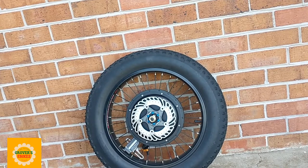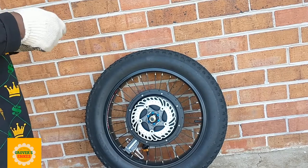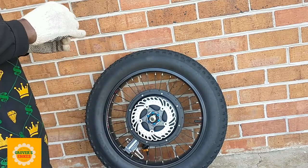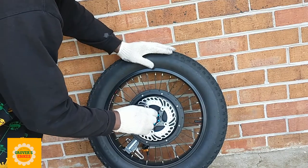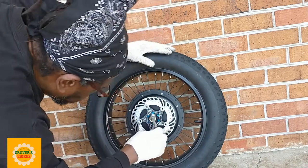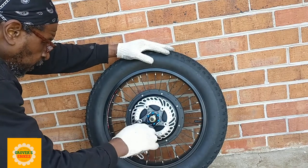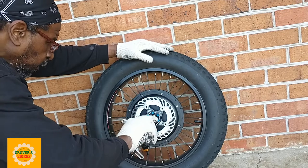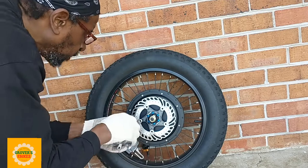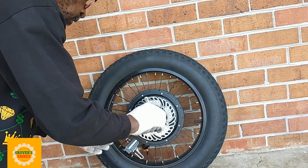So once you have your disc up there, you want to tighten it up the same way, back and forth 180 degrees, and then you want to go all the way around in a circle to make sure that all these little nuts are tightened up. I think it's like, not 40, 4 pounds of torque to each one of these. So, you know, after a while you get a feel for doing it, and you kind of get a feel for what 4 to 6 pounds of torque is, and you have them firmly in place.